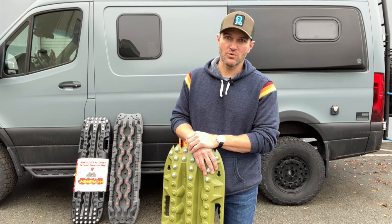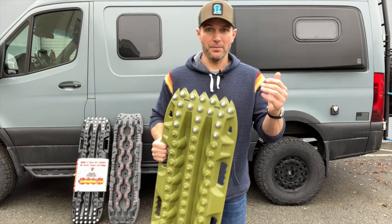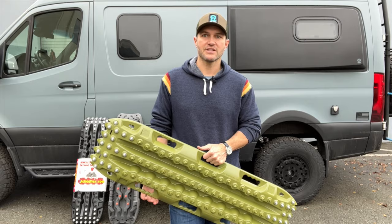If you have a locker, like the one OWL makes, locking your differential will help you get out. Those two would be number one in my book. If those have failed and you're really stuck, or you have a situation where you're helping someone — which oftentimes our recovery gear ends up helping not us but other people — and maybe they don't have a locker, maybe they have smoother tires, not off-road tires, and you need to use these.